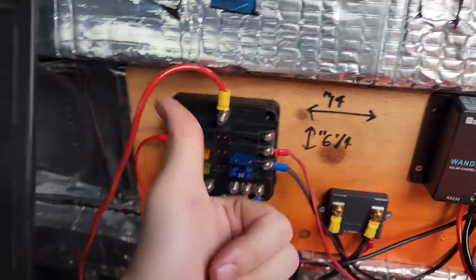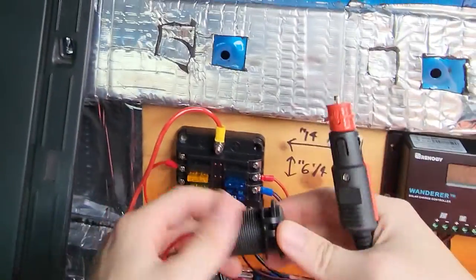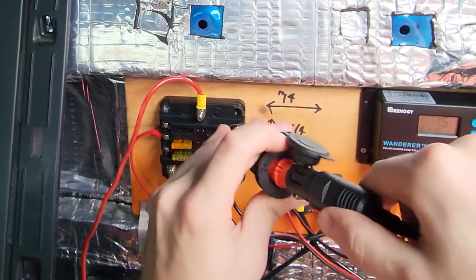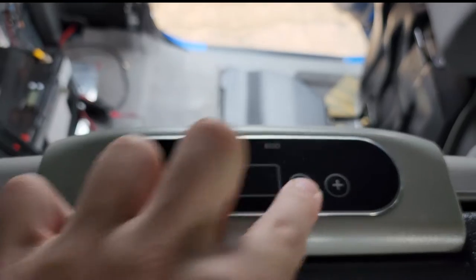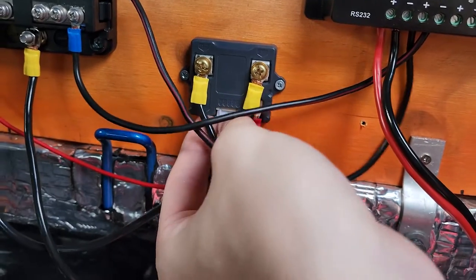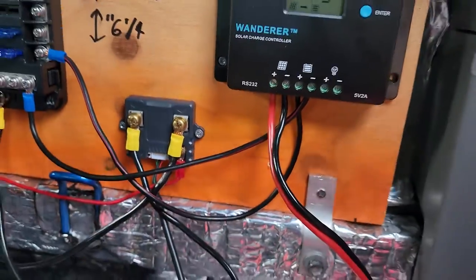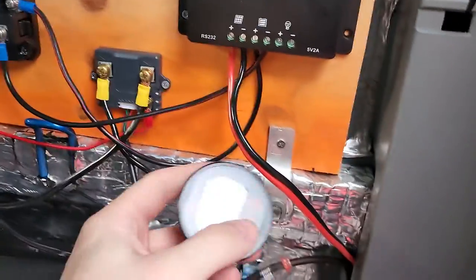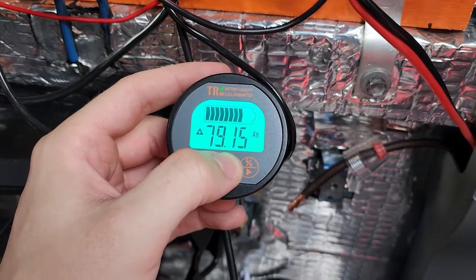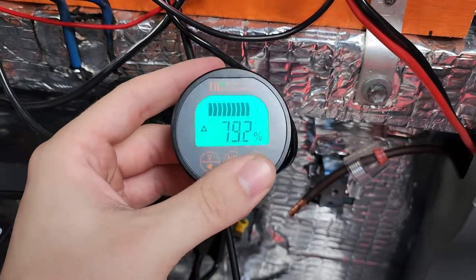Take your 12-volt socket — you'll see it's lit up blue if you use the link in the description — and plug that in. Go check your fridge: it works! Last but not least, plug in your battery monitor and check your pamphlet to see how to set up the desired amp hours for the percentages depending on your battery size. And that's it — now you have a battery in your cab and a fridge for camping.